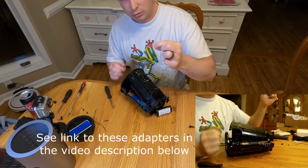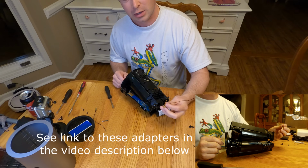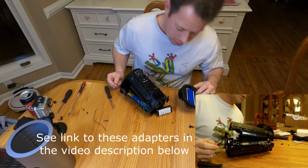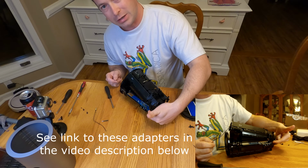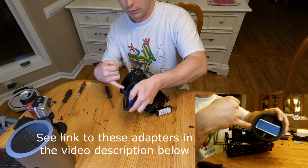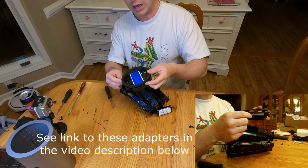So then you can take your new antenna, and don't be like me and plug it right in the first time you did it, because then you'll realize that you don't have an easy way of getting it out of the case. So the trick for that is you want to look at your case, and if you look here, the SD card is right beneath these wires. So you can look here where the SD card came out, and you can fish these in through one of these little vent holes. So what I did is I first fished it through the side post, right?